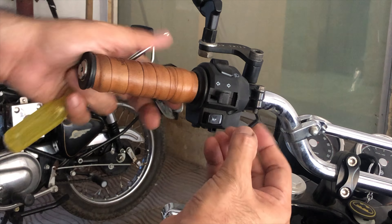The switches are bolted onto the handlebar with two screws that need to come off from either side. Just be mindful that one of the screws is a tall screw which actually goes through the assembly, so keep that in mind when you reassemble the switches back. Once you have removed the left side switch, it's a good idea to put one of the screws back in so that it holds it in place and you don't end up missing an internal part.